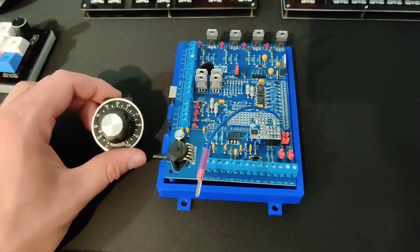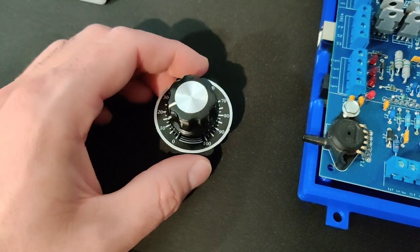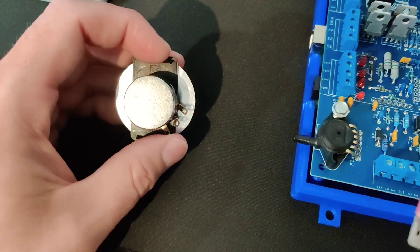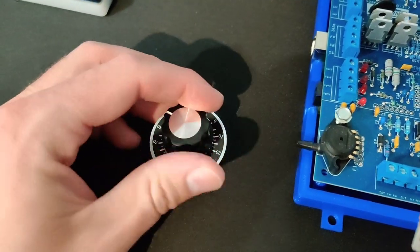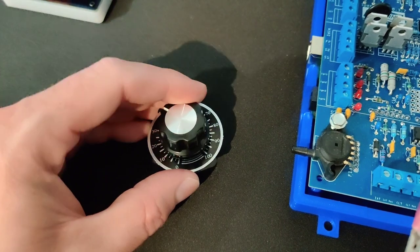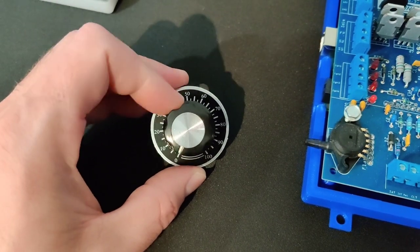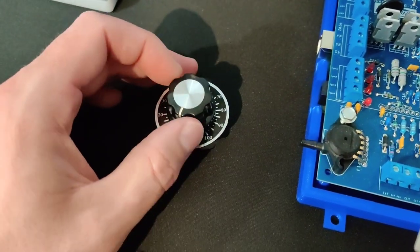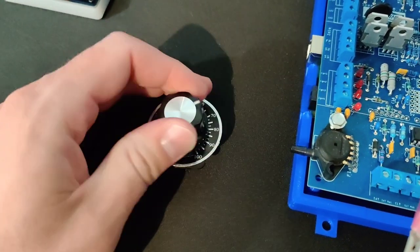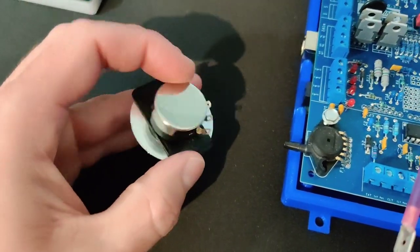We're back in the studio with a few examples. You've probably seen a potentiometer in the form of a knob on a guitar amp — like a volume knob on an amplifier where you start at zero and go over to 100. That's your range. This is exactly what your throttle position sensor is doing — it's telling your ECU a value of zero to 100 as the throttle plate opens, and it uses three wires.